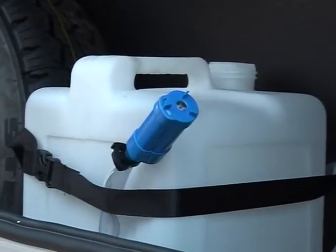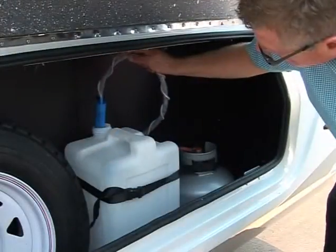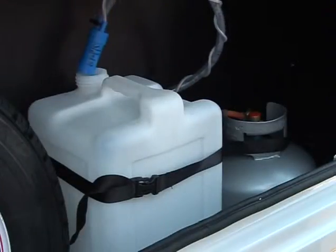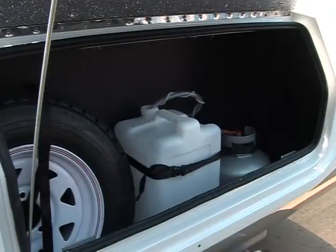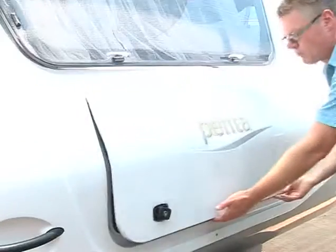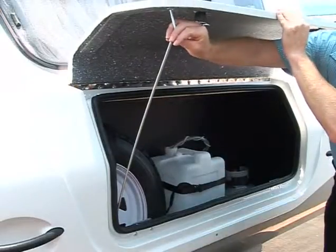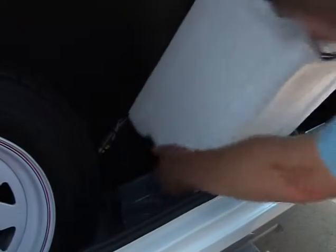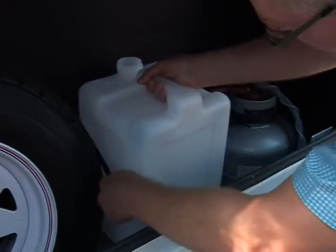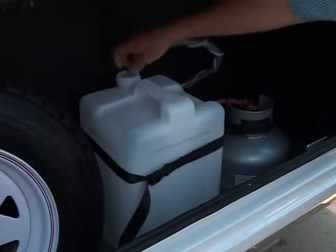The water pump and non-return valve are connected into the plumbing and electrical system. They can be lifted out of and replaced back into the 25-litre plastic water container mounted in the gas bottle compartment in certain models. To fill the water bottle, unlock the compartment lid and remove the pump. When replacing the filled bottle, make sure that the bottle fits securely on the compartment floor and replace the pump so that it rests at the bottom of the bottle.